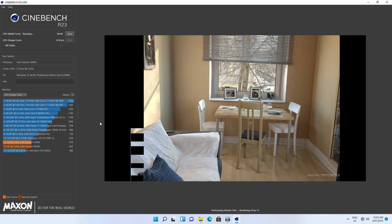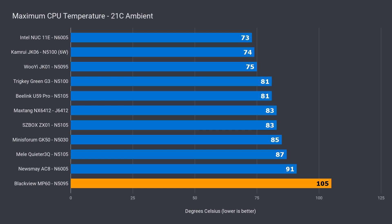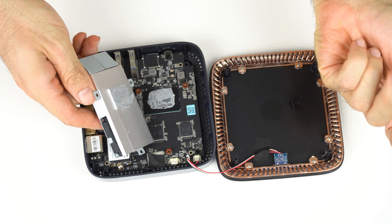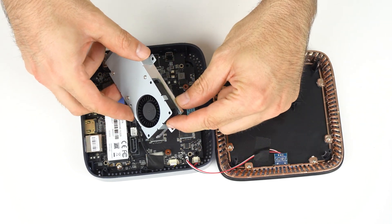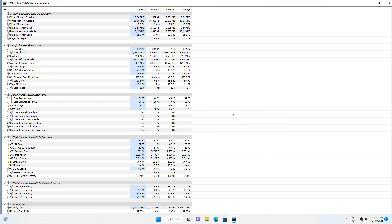However, we need to take into account that when firing up the Cinebench multicore workload, it doesn't take long for the CPU to get to egg frying point. At 105°C maximum temperature, it's by far the worst performer — even the fanless mini PCs did better. The tiny heatsink and fan is not good enough for handling the 10 watt CPU, but I could have told the engineer that just by looking at it. So if you were wondering why there was a drop in multicore performance, it's thermal throttling. The MP60 has to draw cool air from the top cutout and then disperse the hot air back up again, which — well, it doesn't work. It idles at around 57°C, which is surprisingly high for such a low powered CPU with active cooling.